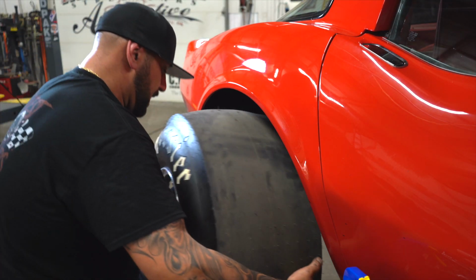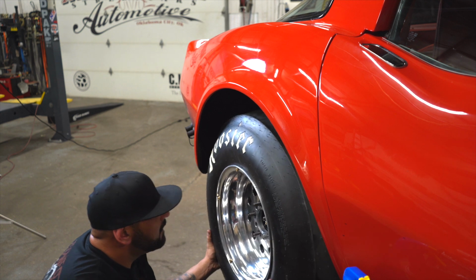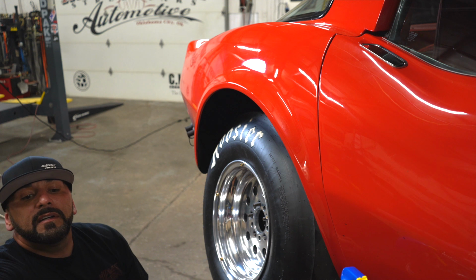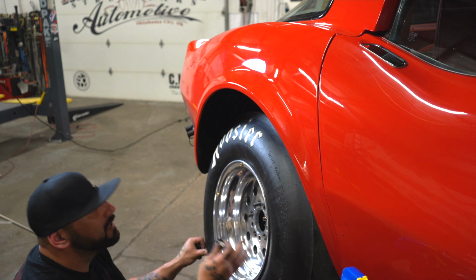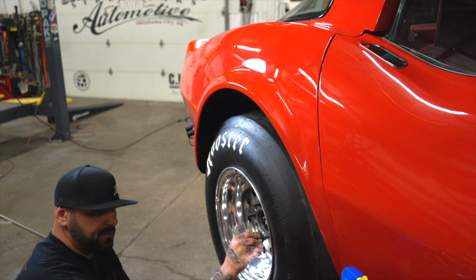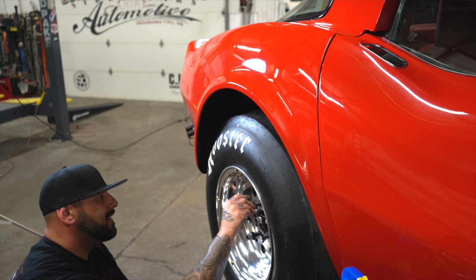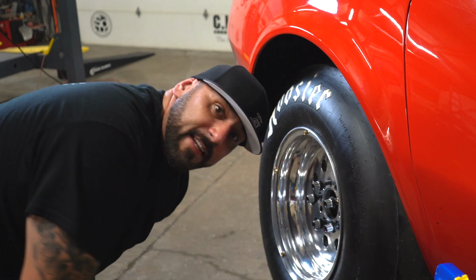In the next video, you will see me attempt to set up, make sure the car's straight, make sure the chassis is straight, ladder bars, set them all up, align, square the rear end in the chassis, align everything, and then set pinion angle, axle angle, driveline angle, all the fun stuff. The very last thing we do is we're gonna put it on the scales, set our corner weights, and lock down the ladder bars and take this thing to the racetrack.